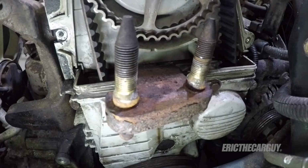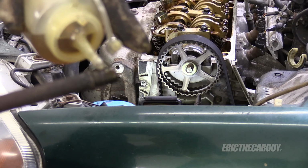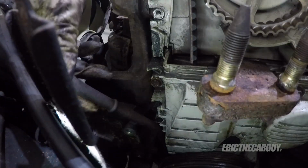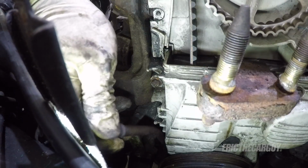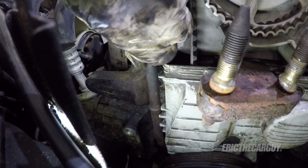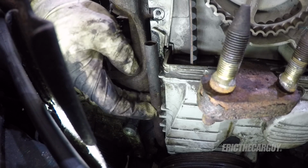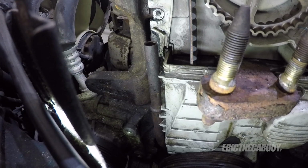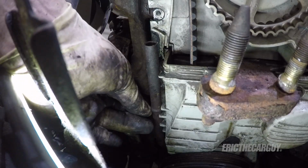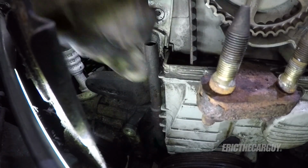Now to reinstall the dipstick tube. And for that, I'm gonna add a little bit of oil to the seal before it's installed. And that will just slide into its home. Hey, don't mess with my light. Okay. You'll feel it hit home. Also, this ridge here will be down below like that. You can then install the holder. Take the hook, come in from behind, hook it in, and then once it's hooked in the back, pull it around until it's secure.